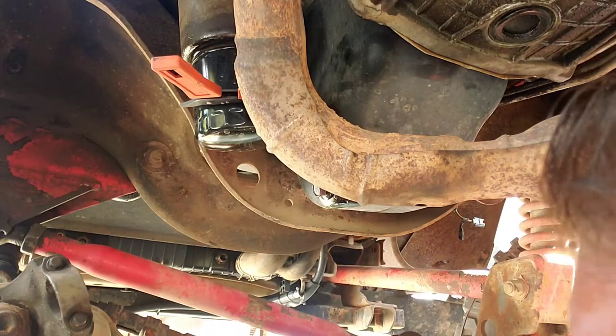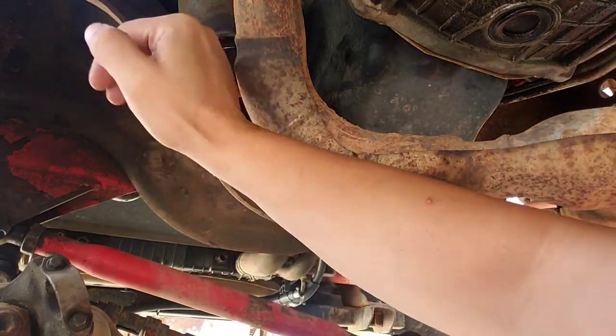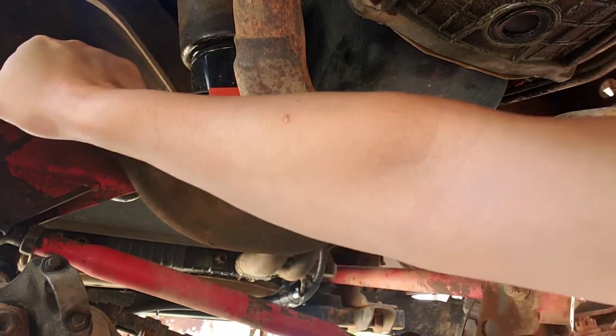Okay, this is underneath your truck, and here's the oil filter. Now, if you need an oil filter tool to get it off, this is what you're going to use. There are at least four different types of tools that you can use to take off your oil filter. There are some straps that are pretty handy that adhere to the uneven oil filter and do just great. I wish I would have had one of those today, but I didn't. I used the one that I thought was just going to work from the get-go, because the one I used today was probably the one of last resort, and it did not work.